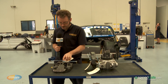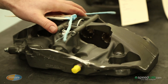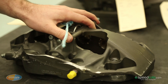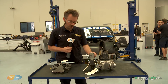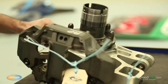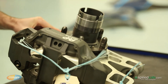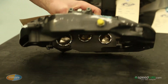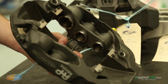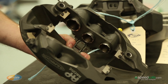As you can see, there's a bridge which is going to need to be removed for the endurance events. That aids the stiffness of the caliper and helps with braking feel and wear as well. On the rear here we can see the rear caliper mounted up to the control upright. In terms of specification, the calipers are pretty similar to last year — the front caliper still has an aluminium construction with six pistons and the rear caliper the same construction with four pistons.